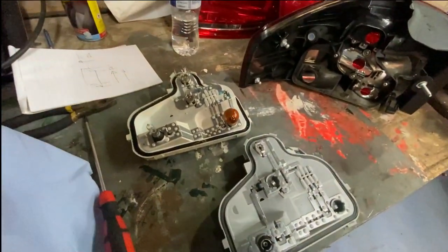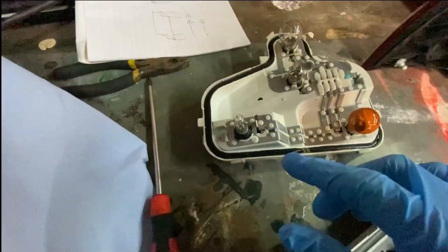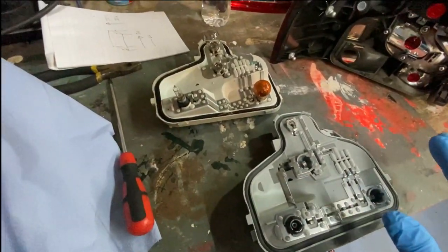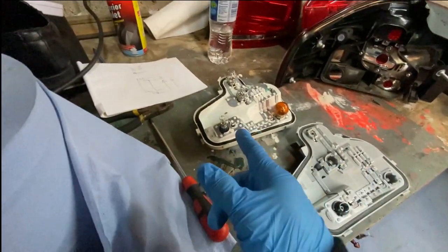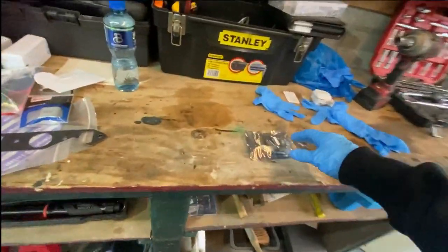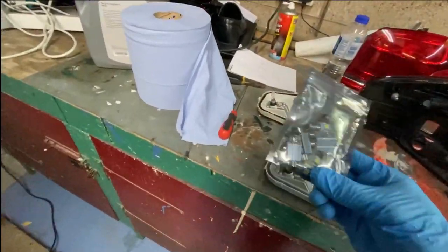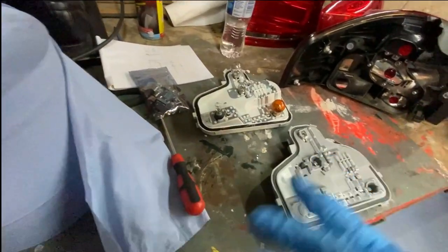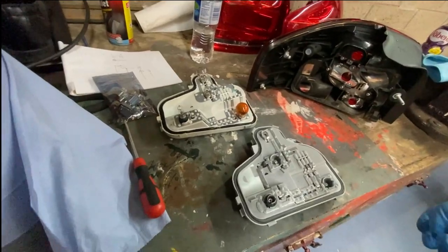The opposite side is a bit different - this side has the fog light, and the fog light bulb is actually different to the other side, but that's literally all that's different other than the top bulb I mentioned. I'm just going to swap over the ones that are the same. I've got the pack here - most of them are just canbus LED lights, a straight swap. Make sure they're canbus so you don't get any errors.